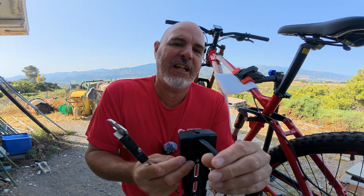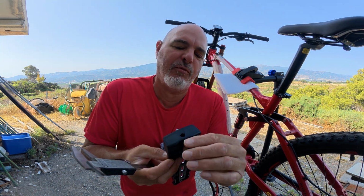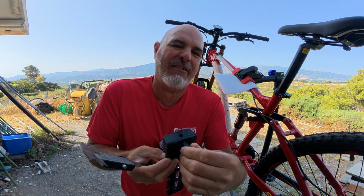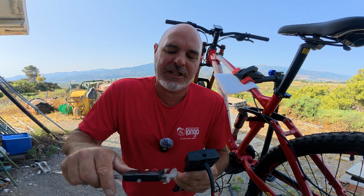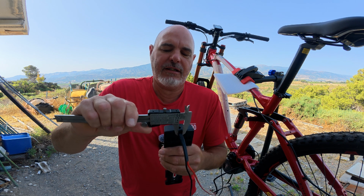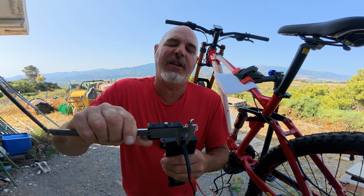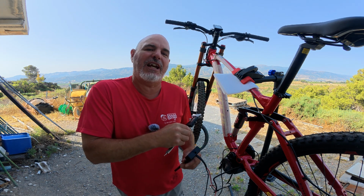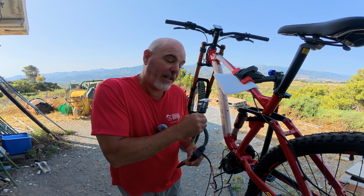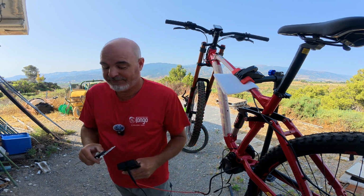As you probably just saw in the B-roll a minute ago, I've shrink wrapped this really well so it doesn't get burned on the hole, because I don't intend to put a grommet in there and make the hole even bigger still. So let's quickly measure that. And we've got 9.5mm there. So we're going to have to increase this from the 8mm hole to a 10mm hole with our special contraption and get that done. So let's do that and then we'll move on.